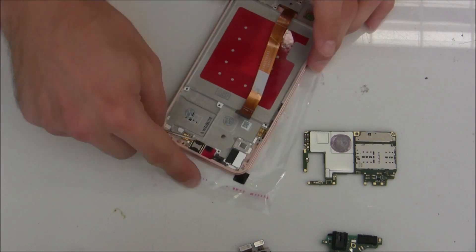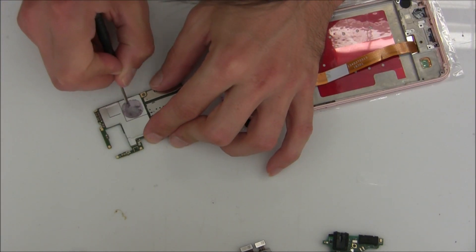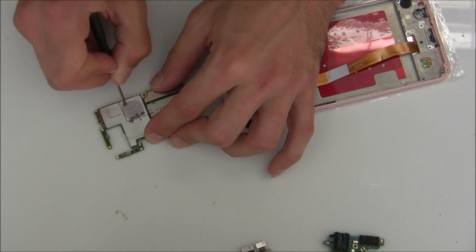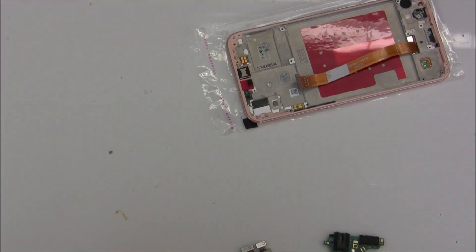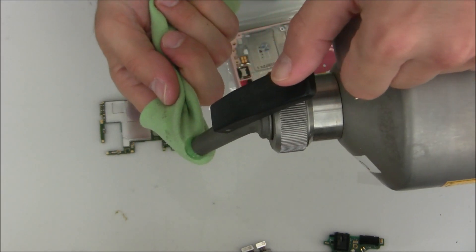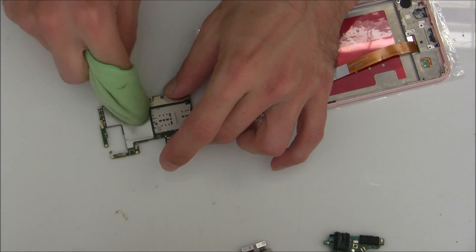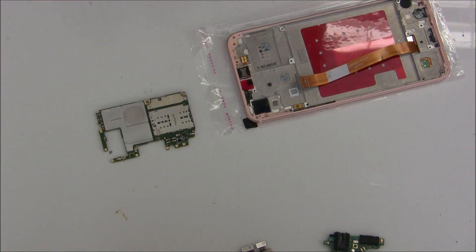As you see, there was some heat sink before — this was the old heat sink. So we will have to remove it here. I will remove this rest and then clean it and we will use a new heat sink. I'm cleaning here this stuff with some isopropyl alcohol — or you can just use 80-90% alcohol for cleaning, or whatever you have for cleaning.